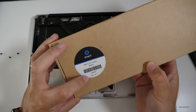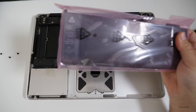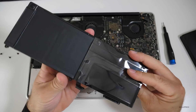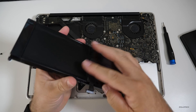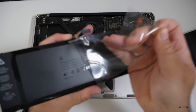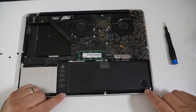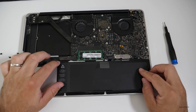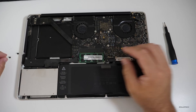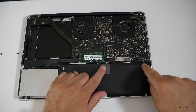Here's the brand new battery — you'll see there's the part number right there. Let's open it up. It's wrapped just like that, so we'll unwrap it here. What we can do is put it in place just like this, and it sits under these tabs right here. It sits down just like this, and we need to pull this back to get these screws in. We'll put this down, and then a screw goes here, another screw goes here, and one over here as well.